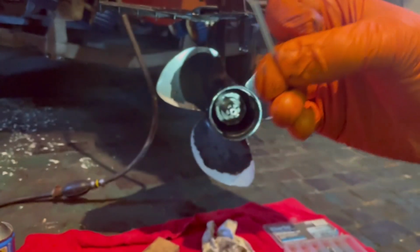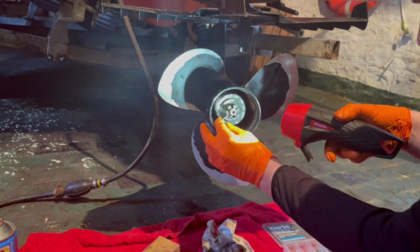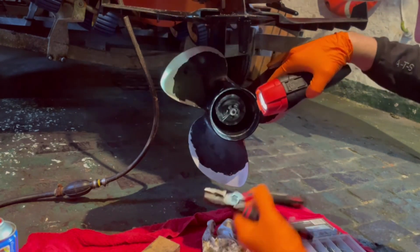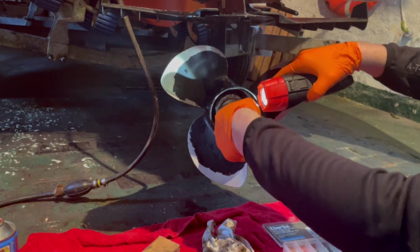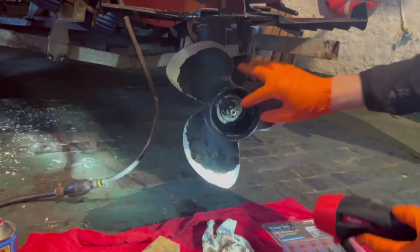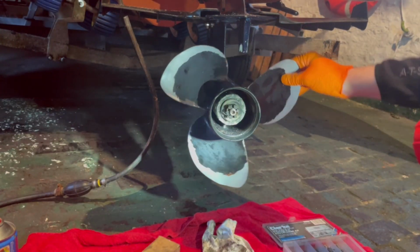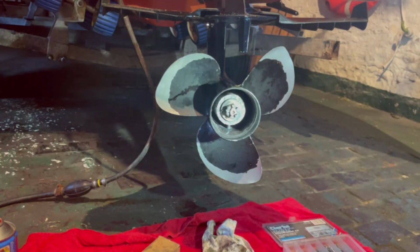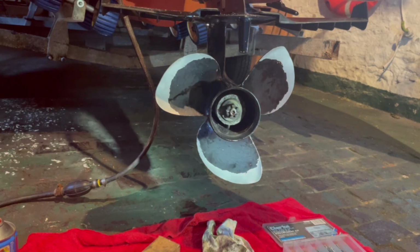So here's the split pin, and what we'll do is drop it through the hole. So now it's through, we bend the arm back. Pliers on that. One side, two sides. And now the nut can't back out because that pin is in the way. And that's pretty much it. Very easy job, anyone can do it really, as long as you've got pretty much lumber wood, a 27mm socket, breaker bar, bit of grease, good to go.